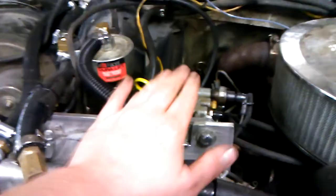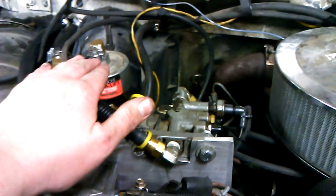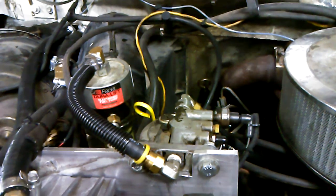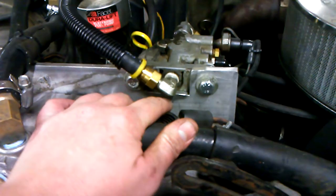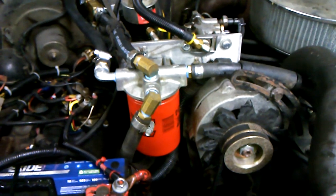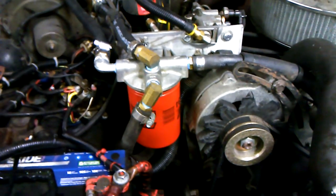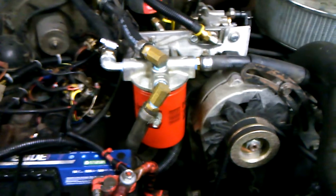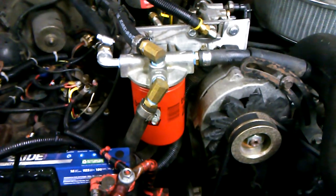In short, I moved my facet pump back. I built a whole new bracket for it — I welded an aluminum plate, made a T-type bracket and mounted that where the AC can was mounted before. Then I got another aluminum plate, notched it out from my lift pump feed line to my filter housing, bolted it right to that, and bolted the coolant filter right to that plate. This is still set up as a bypass, and I realize I overthought it and didn't utilize the full potential of this filter housing.